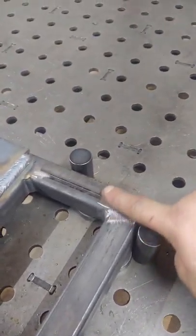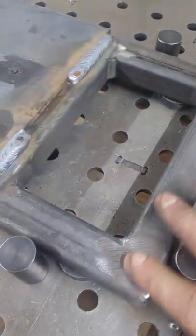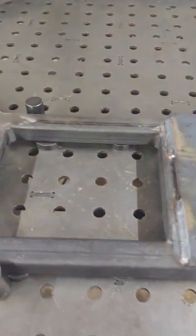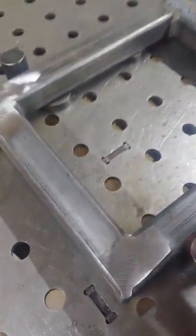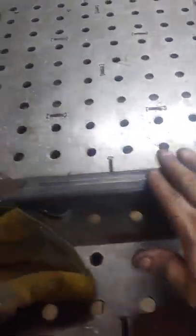This is the front side. We grind it flush — you need that bevel because you can see there's no line at all. You want that to be 100% strong and not break. This is where the axles go; you can see the pre-drilled holes. There are three inch welds on the outsides of these, making this super sturdy. For the big frame it handles 1,200 to 1,400 pounds no problem. When we powder coat it, it looks real smooth and nice.